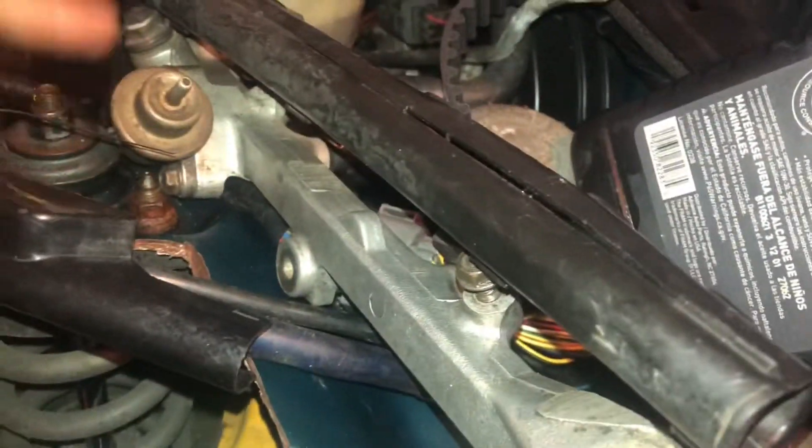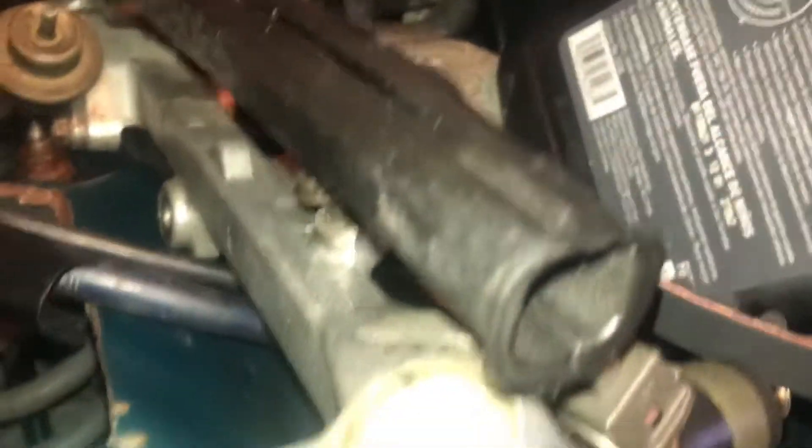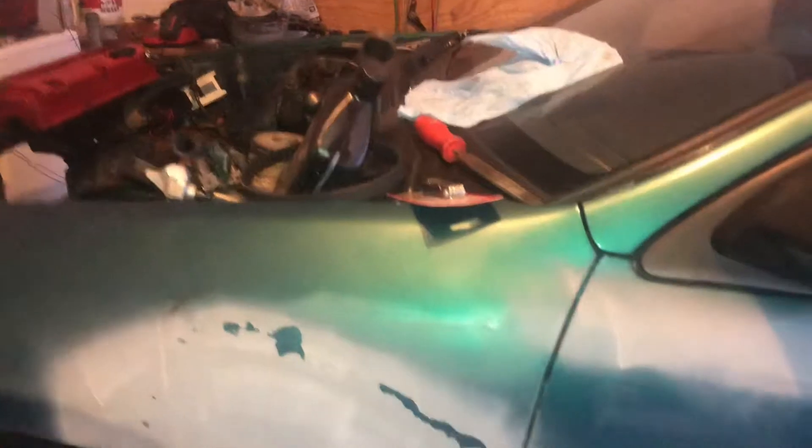Here they are. There's a factory regulator I've got to swap out for my adjustable one. We have our FIC 950s, which will probably cap out at around 500 horsepower, but we're going to run it on this fuel system now just to see what it does — basically break it in on medium boost. If 12 pounds was low boost, this would be medium, and high boost would be whenever we get 1600 to 2000cc injectors, whatever we want to run.